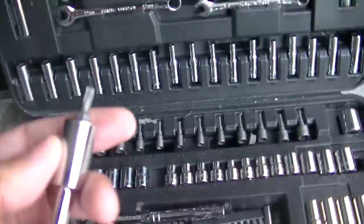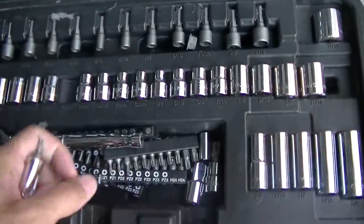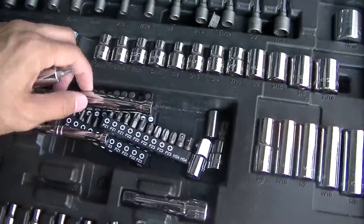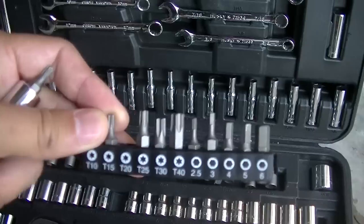All right, to my nifty tool set. So back here — sorry it's a little hard to see, let me get a flashlight. Okay, so back here we have one here to open up this liner and then there's another one here. So I'm going to undo these two, pull it back, and then I'll show you the screws on the inside — two of them that hold the bumper in. For those two, they are going to be a T20 Torx.